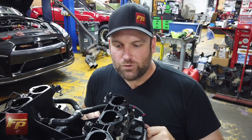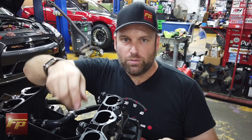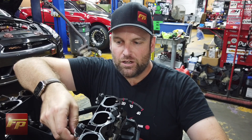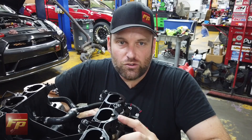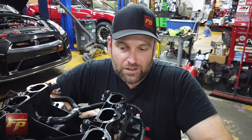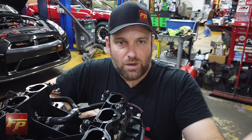That wraps up what was being done on the intake manifold itself. Greg was installing a few more check valves on the manifold, and we also had to replace all the little rubber grommets and reinforce them with solid aluminum pieces to get a better bite on the manifold — because this whole manifold is plastic. You've got to do everything you can to make sure those seals stay intact under manifold pressure. That's one of the biggest reasons as you go up in power, these things require a billet intake manifold, which AMS and a few others have come out with — and we'll definitely be using the AMS one. Next, you'll see us reinstall the intake manifold and make modifications to the cooling and oiling system for oil and water feeds to the turbochargers.